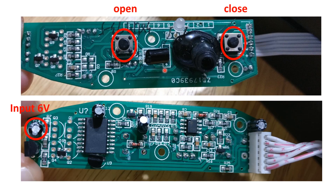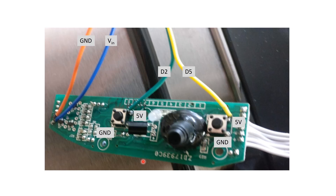Turning it around, I found a six-volt input capacitor, and a voltage regulator that converts it to five volts. I'm guessing this chip controls the stepper motor that opens and closes the lid, and this is the microprocessor — though it could be either or. I probed with my multimeter and found that the open button has a five-volt pin and a ground pin when active. The same is true for the close button.